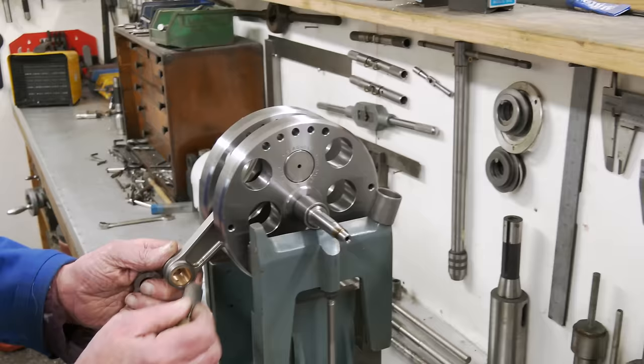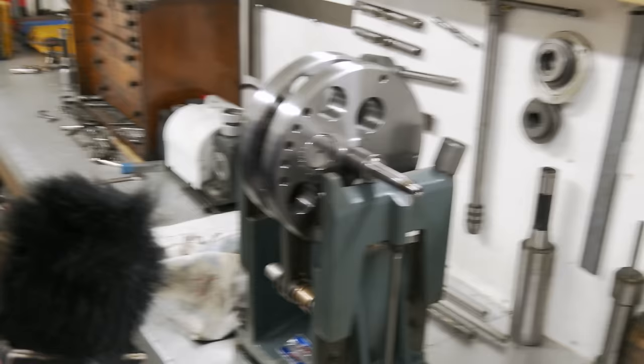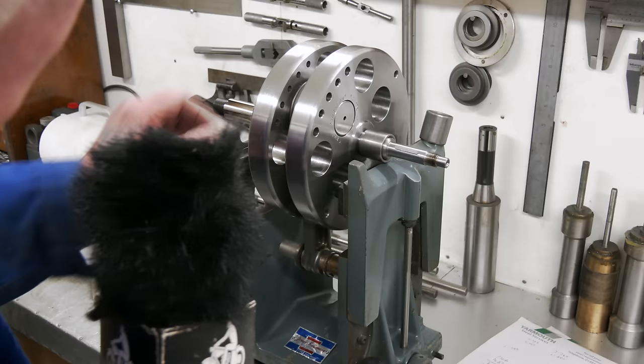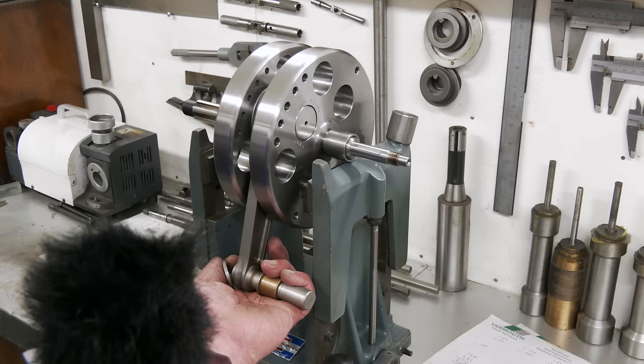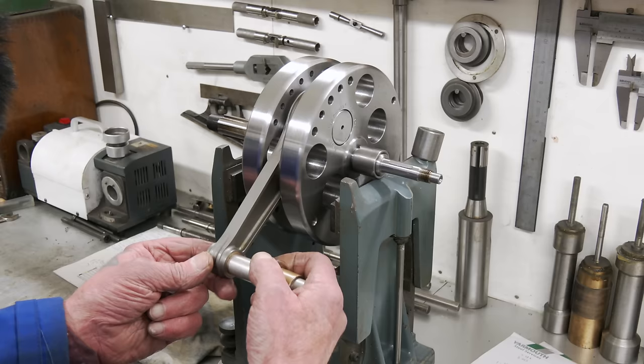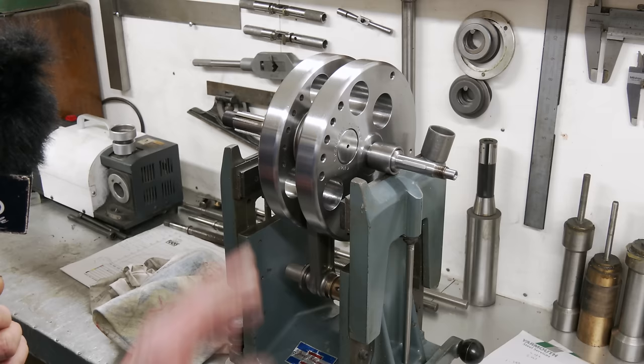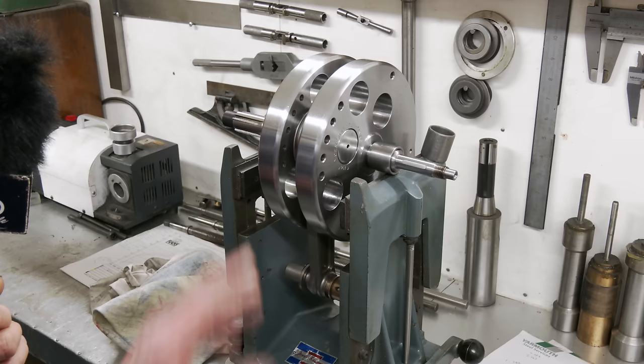So Phil is replicating the 244 grams to hang on the end of the conrod - that substitutes the weight of the piston and is the balance weight. These sleeves are to keep it equal both sides. That's just a little bit off the bottom, you see. If you don't have the weight on it, that'll just shoot up to the top. The crank is already done at this point, so it stays at any position.